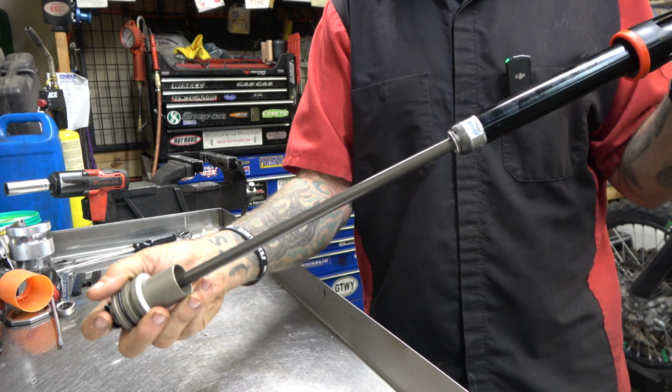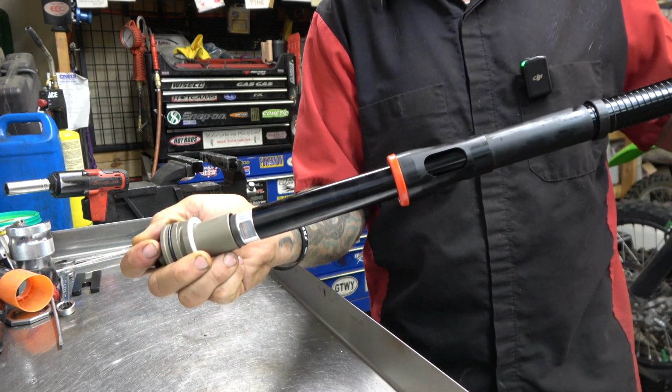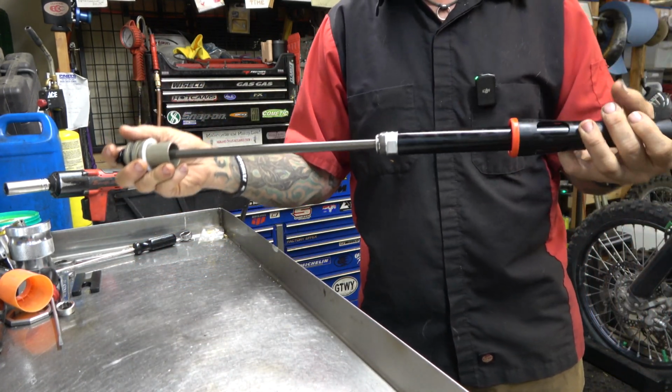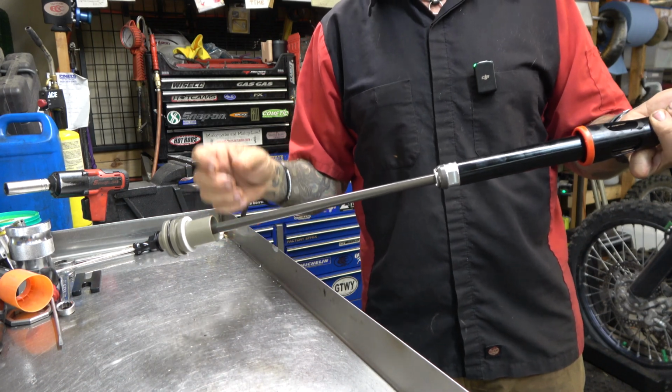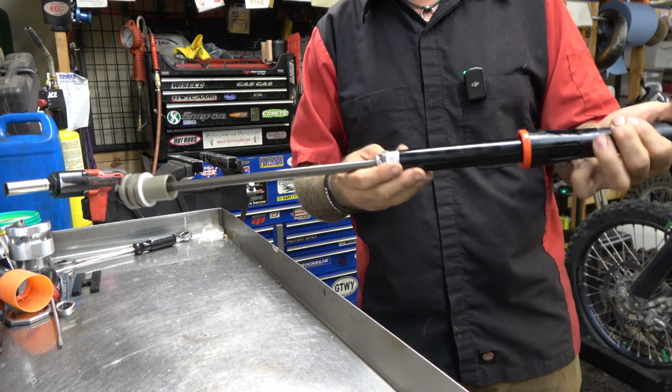I want just normal damping all the way down to right there, and then I want it to catch me just like this, which is much closer to the hydro stop on my air forks that came on my 23 bike. And this is much closer to what the 6500 kit has too. I think this is probably better.